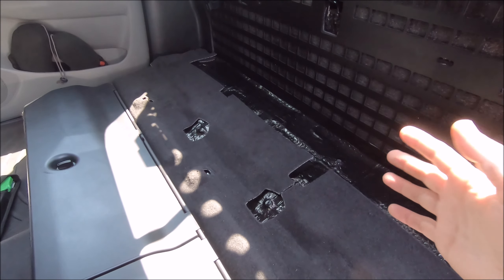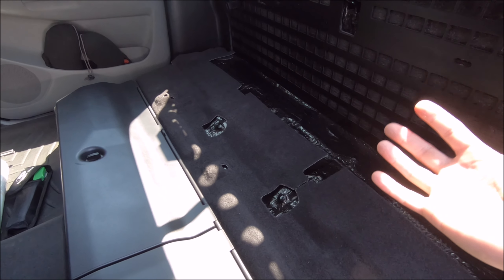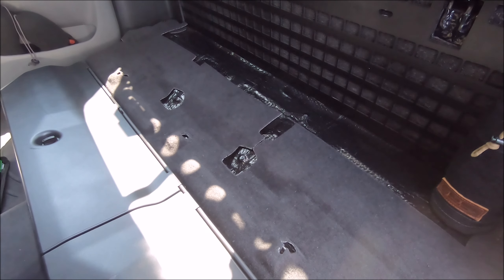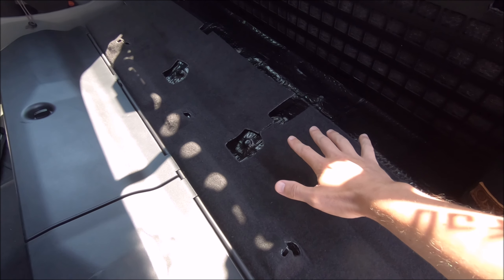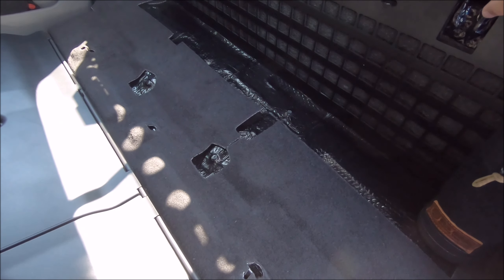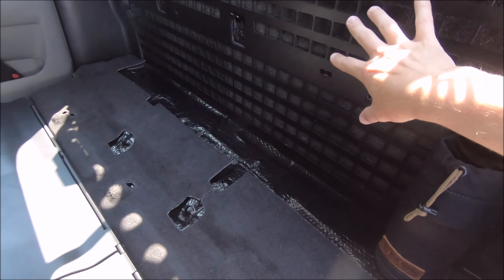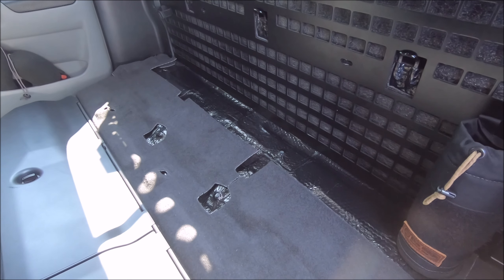Obviously I have the room to put a huge subwoofer box back here. However, I want it securely attached. So I went ahead and cut a few pieces of three-quarter inch MDF — one I'm going to use for the platform here on the bottom, and then I'm going to actually attach the bottom platform to my MOLLE panel right here, since that is secured with about eight bolts holding it in, so that's not going anywhere. I'll show you how I attach that in just a second, but let me show you the pieces real quick.